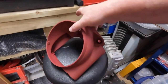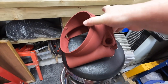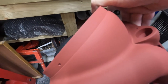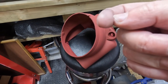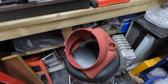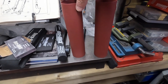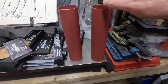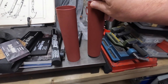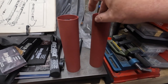I've painted the nacelle just in undercoat. It's had a good few coats and a bit of filler on it where it needed it. There was just one of those little holes that are welded up on the side — you can't see it now, but there was a hole there and a slight half-crescent left from spot welding. I filled that, treated it all, and she's had plenty of coats inside and out. The fork shrouds — these are the bits I want to get done pretty urgently. They're in undercoat as well, good few coats on them. Bit of filling on one because I think it had been dropped on one side. I actually put it in the lathe and rubbed it down as much as I could — couldn't rub it down where the ears are because it would have chopped my fingers off. Done a fair bit in the lathe.